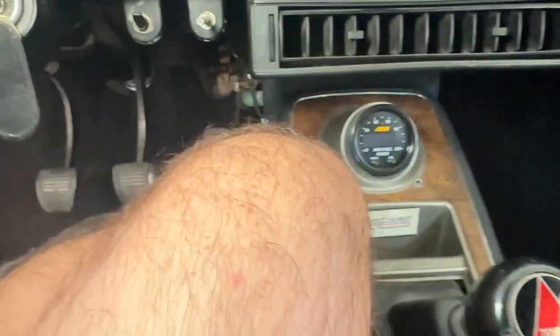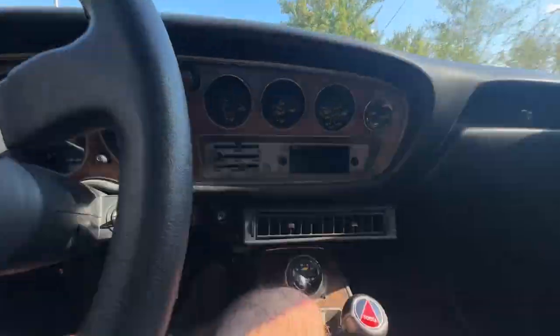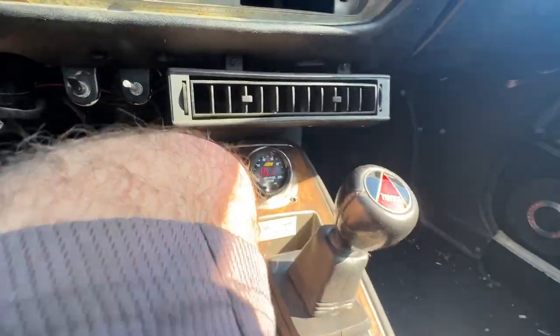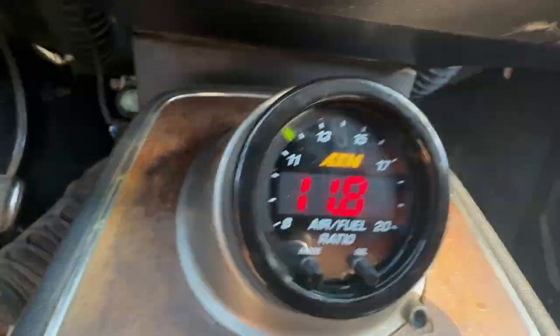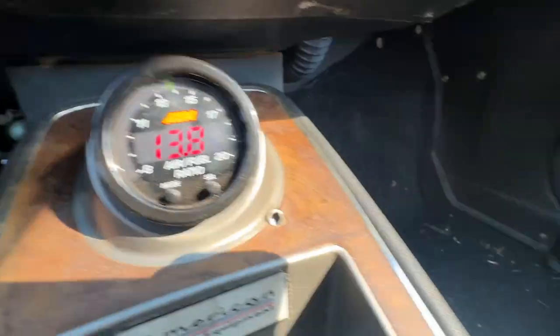So with the gauge installed, we were able to go out and test. And when we tested, it was hard to adjust the carb, but I put a double pumper sprayer in and got the jets adjusted. It's an ongoing battle. It changes with the weather, right? Carb adjustment. But it's so much better now than it was previously. And with the gauge installed, it allowed us to move on to the valve adjustment, which was a little bit more of an adventure than we thought it would be. We'll save that for the next video.